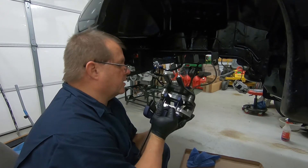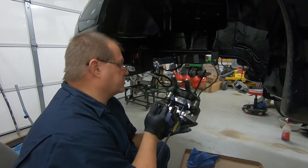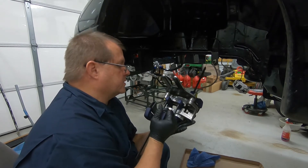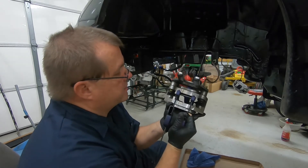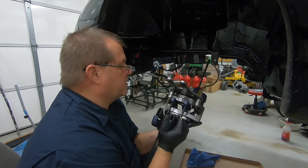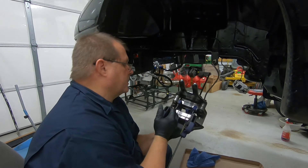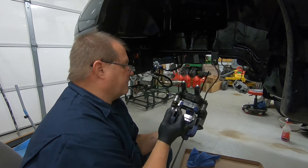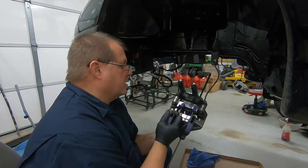Sometimes you have to reposition where you're squaring up on the puck — sometimes it goes at an angle and binds. If you just release pressure off of it and keep pushing down, you can see these pucks are moving. Finally got those down — just about there. Do the same thing on this one: reposition the clamp, release pressure, and push.